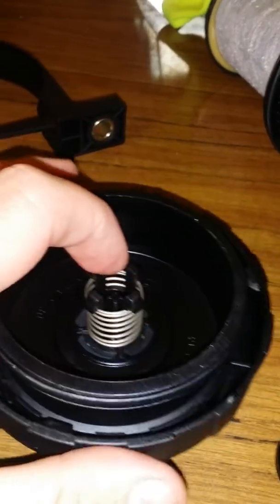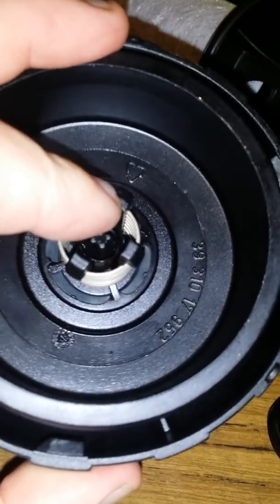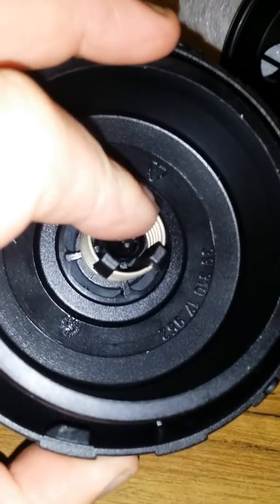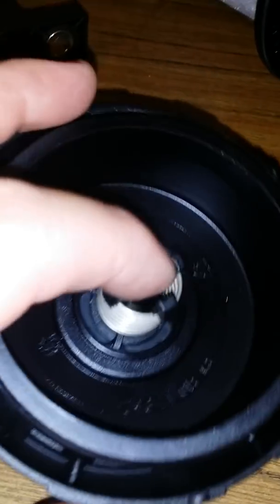This is the top cap, which acts like an overpressure valve. So say the can is full of oil and gas isn't flowing through anymore — if your blow-by gas can't get out of your engine, because this is blocking it, it'll come out through that valve, which will open and let the excess pressure out. The gases will come out between these two plastic bits and go out here.